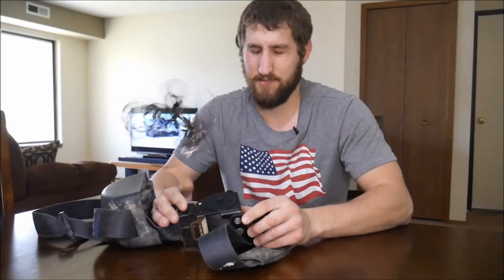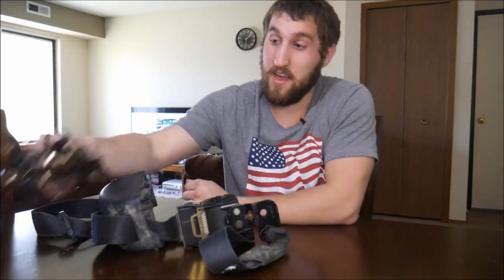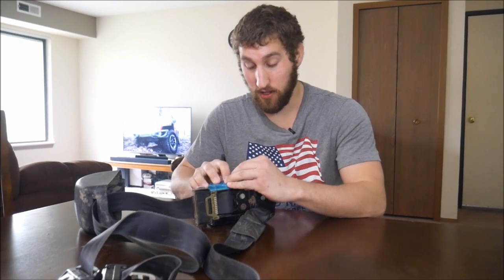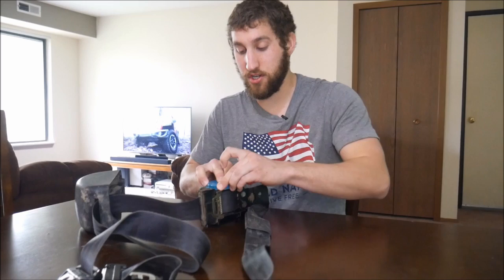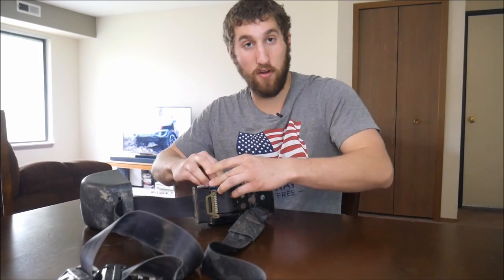Because if you let go of this cover, well, this happens. And then your spring is in a mess. So you don't want to let that happen to you. So make sure you keep this plate pressed down. But to add more tension to the spring, all you have to do is rotate it counterclockwise. And this will add more tension on the spring. And then your seatbelt will retract better.